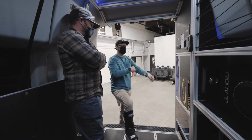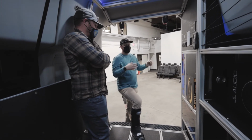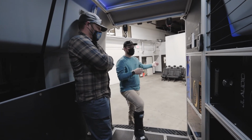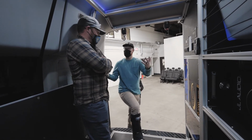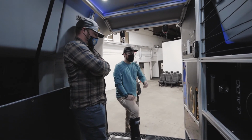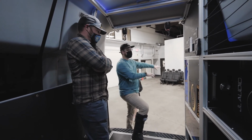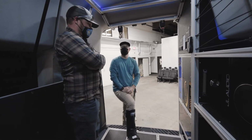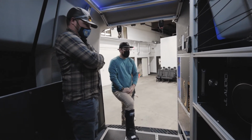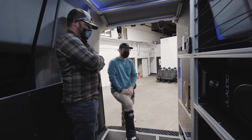Most pop-up campers or old RVs would only be powered when you plugged in shore, because shore is AC power. It had a transfer switch. It made outlets and air conditioners work inside the van. Doing so bypasses our batteries. Your air conditioner and everything is being powered directly from that shore power connection. So yeah, 3-in-1, and if you forget, it is listed right on there, which is pretty handy.